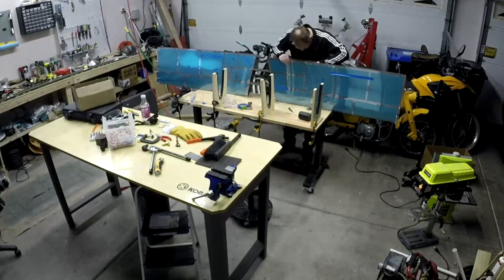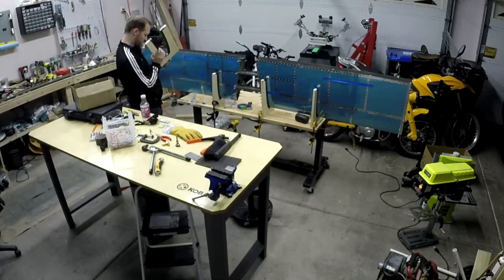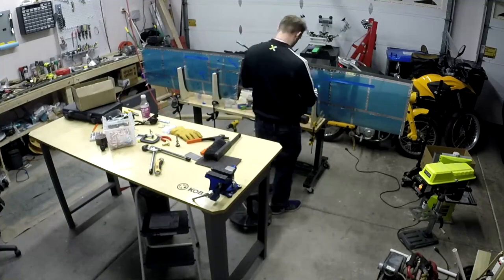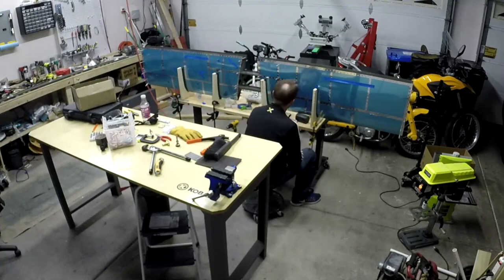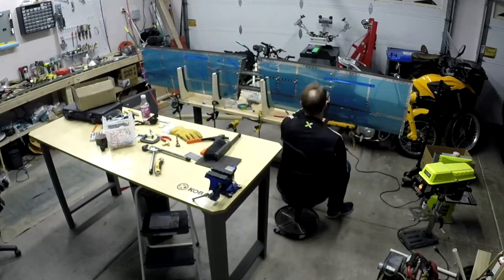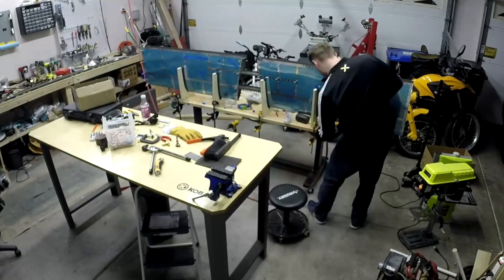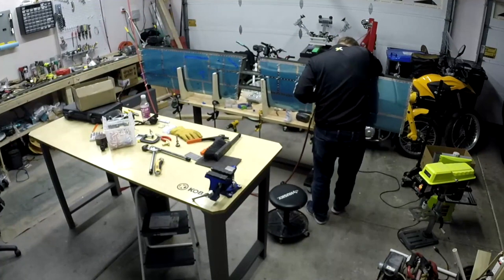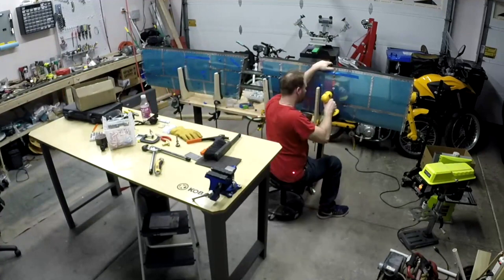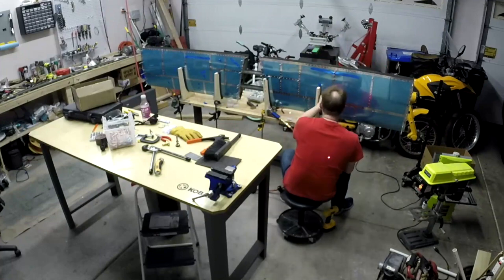So, for example, the fuselage kit that I ordered, I don't know what fuel system I'm going to use because I don't know what engine I'm going to get yet. We already talked about this, I think. It's probably going to be Lycoming, but I'm going to Osh, and I'm going to have conversations, so I'll see what comes of that. Like I said, it's going to be the same price if I order the fuel pump now or later. So just in case it changes, I told Van's to delete the fuel pump and the fuel lines and a couple other things. Oh, the fuel valve, right? Because if you need a return valve, then you need a different fuel selector valve. So I had them delete a few things from the fuselage kit that are easily orderable later.